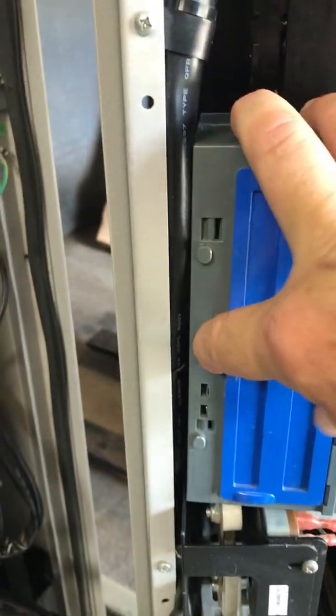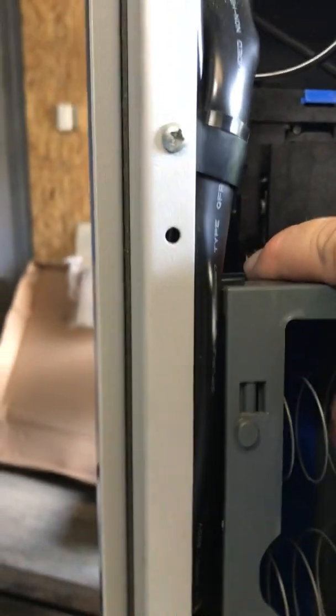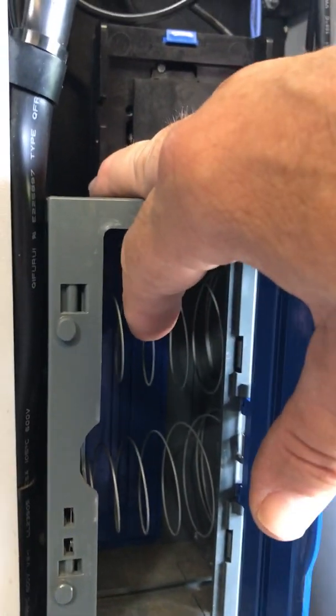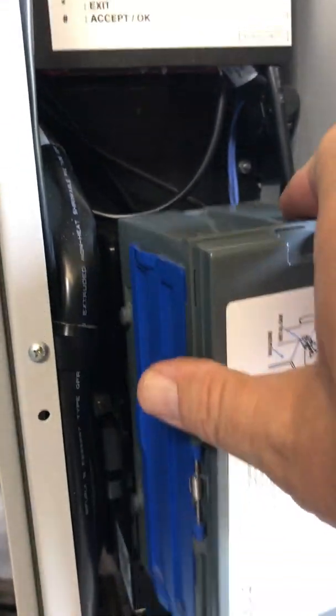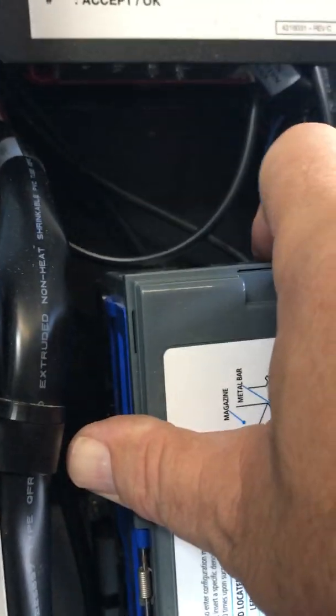This little door here — open it up — and then your bills will be in there. When you take the bills out, be careful: there's a plate back there that gets pushed in when the bills fill up. Make sure the springs are straight and not cocked, because if they're cocked it's not going to accept any more bills. When you're done, just put the box back — there are little latches, just position it a little above and drop down and it's locked.